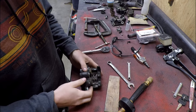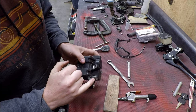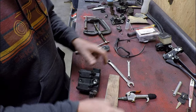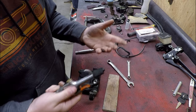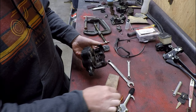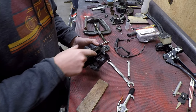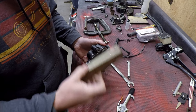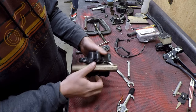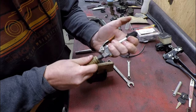Alright, so the first and easiest thing to try is using compressed air. What you're going to want is to make sure you have your bleed nipple seated in the caliper. You're going to want to have this fitting open and then you're going to need an air chuck with some kind of rubber tip on it so it seals. Basically you're going to be forcing air in here trying to push the pistons out. Now, word of caution here — you do not want to just leave this exposed because if the piston comes out, it can shoot out somewhere and damage things.